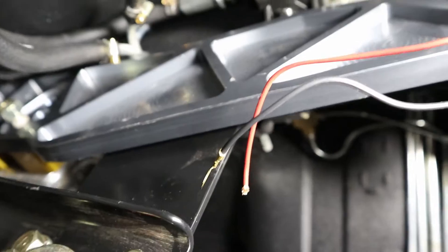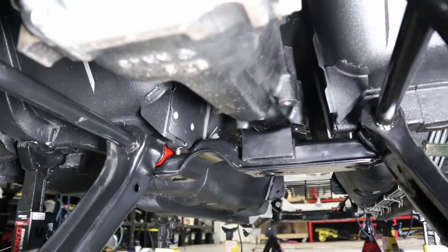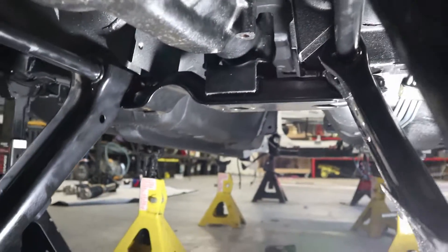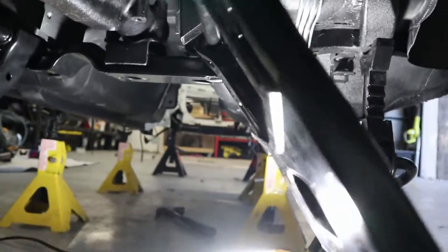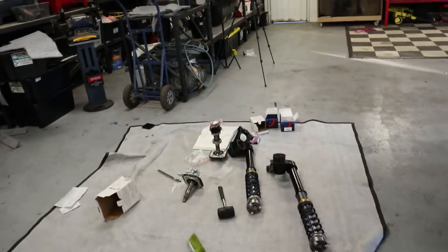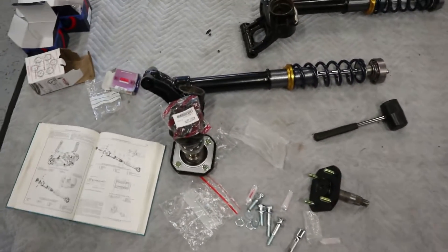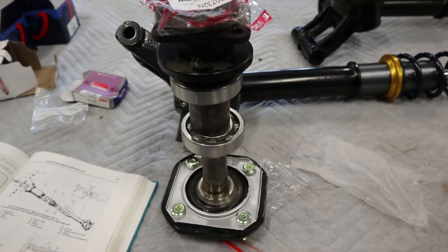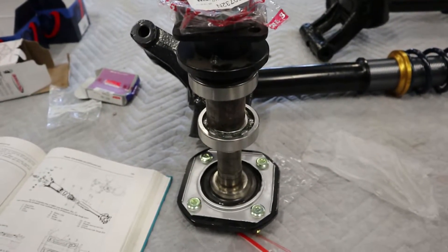The bracket still fits nicely at the top and is out of the way. I'll just shorten this bit of hose a little to bring it back in tighter so it doesn't hang down too low. The arms and bushes are all on and ready to go. I've left the nuts loose because I'm missing a bolt at the front on the driver's side — I'll just get a new bolt, drop it in and tighten everything back up. Next job will be getting the bearings pressed into the rear hub carriers on the rear coilovers — we've worked out the sequence from the book and a great YouTube video Brad found. I'll press them in at the office during the week and hopefully get it all fitted Monday night.